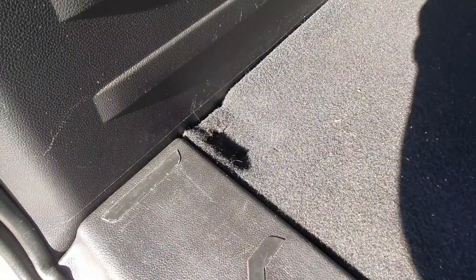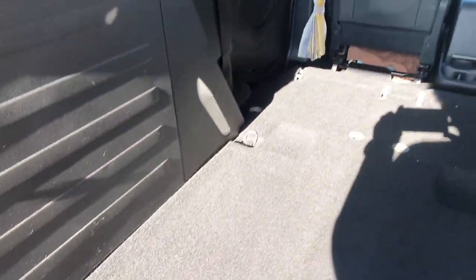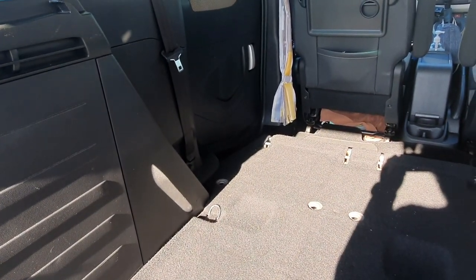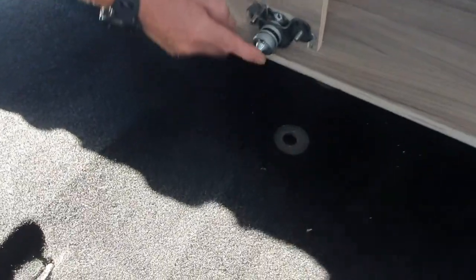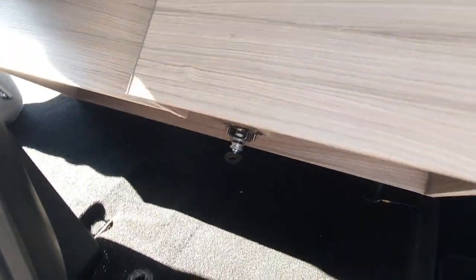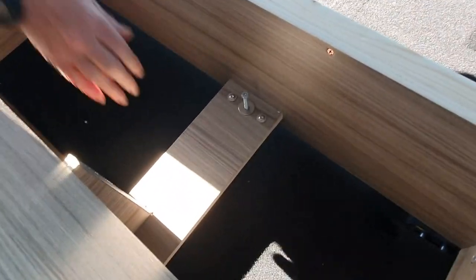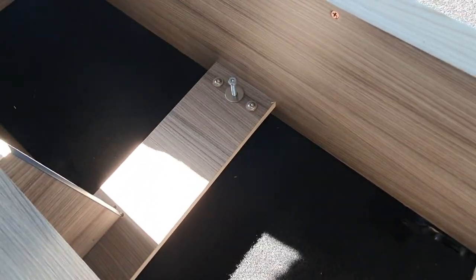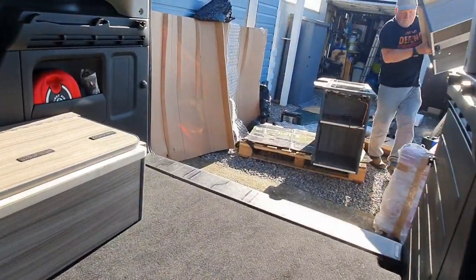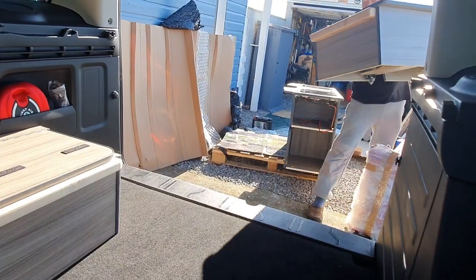In preparation to fit the unit, we had taken out the D-rings and cut some of the carpets away at the back, and also removed all of the seats. Fitting the benches has been made super easy because these little clips just push down into where your seat would usually fit into the back of the vehicle. Just lay it on, pop it in position, lift the lid so you can see, and then just apply some direct downward pressure and it will click in. To remove it, you pull up on that large bolt, and repeat the process for the other bench.